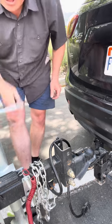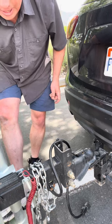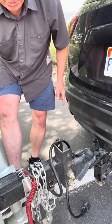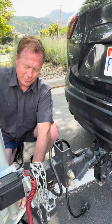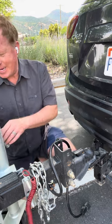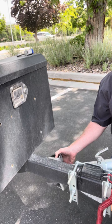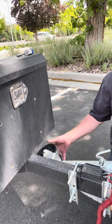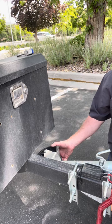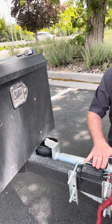Now it's latched on. Always make sure you've got the wheel blocks on when your car is not hooked to the trailer, because you don't want it rolling. To retract the jack, pull the handle out and swing it counterclockwise. The wheels on the jack swivel — you want the part that sticks out to face toward the driver's side so it fits into the area right under the box. You'll hear a click when it's all in.